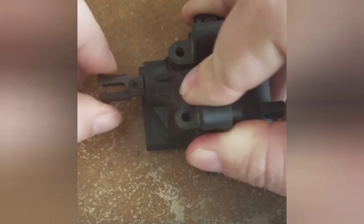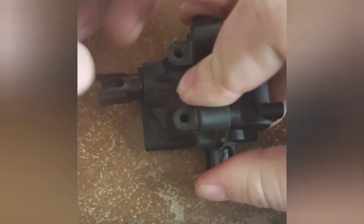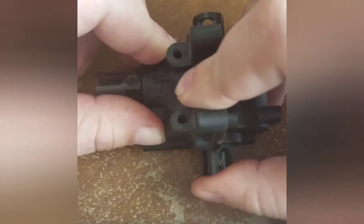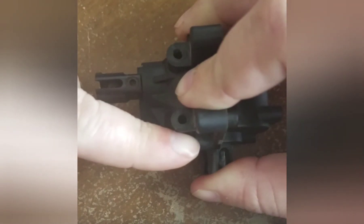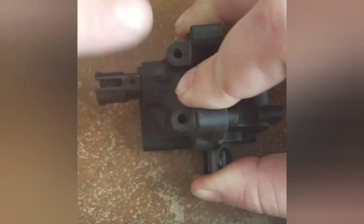I'm going to push it from the opposite side — a little bit more pressure up here on the opposite side — and you can see the mesh actually got worse. I'm going to apply a little bit more pressure on this bottom side, and it got tighter. So I know I'm going to have to put a shim on this side to take up the gap by pushing the diff this way.